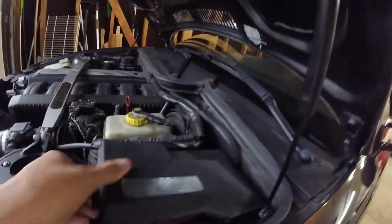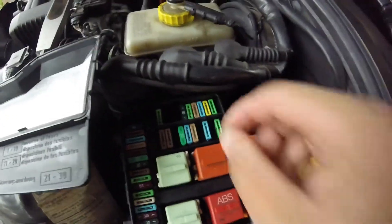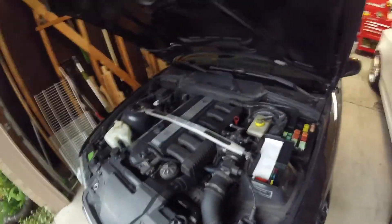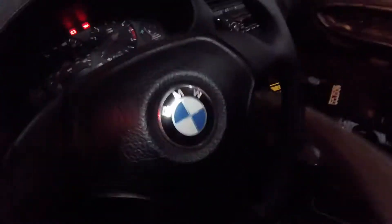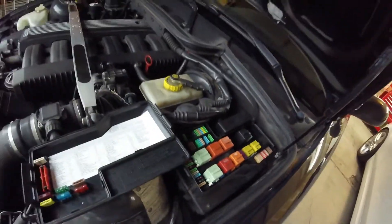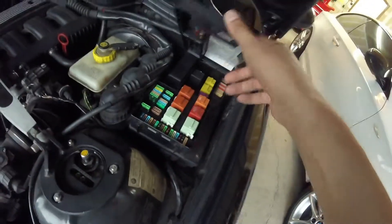Ideally do this outside, but it's raining. On the back side of the cover there's the key — we're looking for fuel pump fuse number 18, which appears to be 3 from the end: 20, 19, 18. Go ahead and pull this fuse straight out and wait about 30 seconds until the car dies. It kind of makes you cringe because it sounds sick. So you let that die, go back and turn the car off, then replace the fuse. The instructions specifically say to turn the car off, then replace the fuse. You are now done with the fuse box.